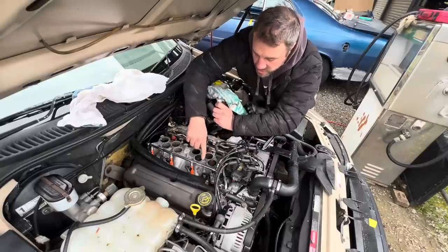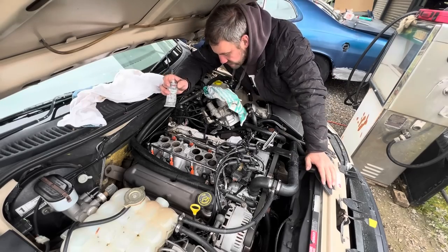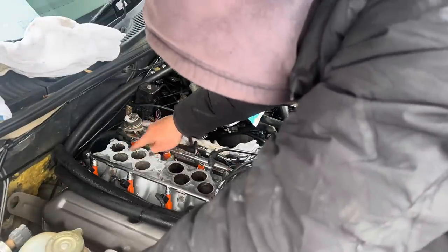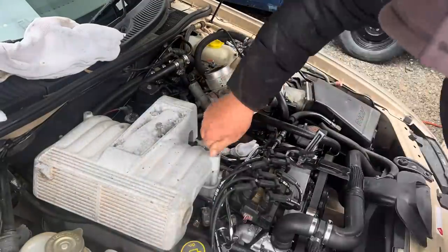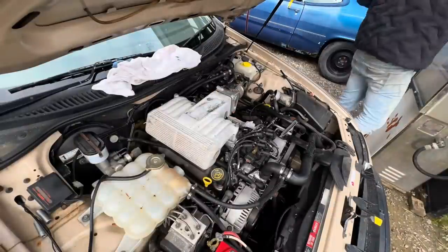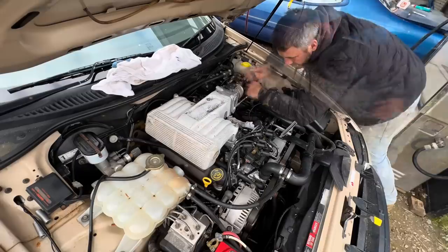I'm going to give this a good rundown with some grey silicone sealant, get this intake manifold all on and try and remember where all this wiring goes. One of the first things you might notice is the amount of silicone sealant I'm slapping on this intake manifold. I probably went a little bit overboard, but the reason being is that this is actually a second intake manifold I've used on this car. The first one I painted up all nice and pretty, but when I put it down it was sitting a little skew - I didn't realise and I actually cracked the intake manifold. These things are very brittle; they break like an Easter egg if you put tension on it in the wrong spot. So I ended up replacing it, and I've just been a little bit cautious since then. More silicone, less tightening.